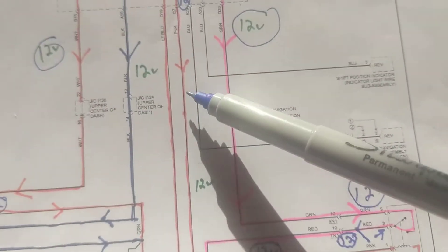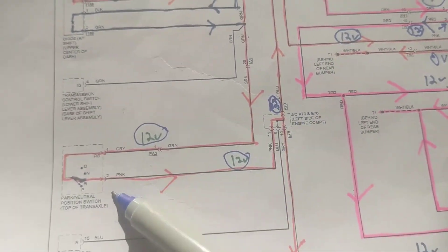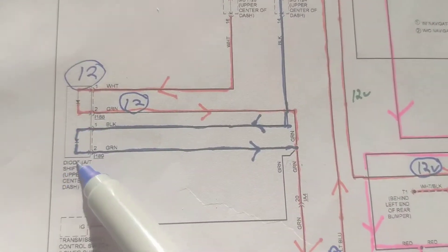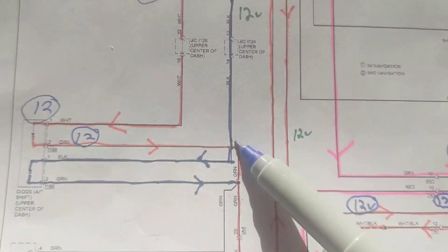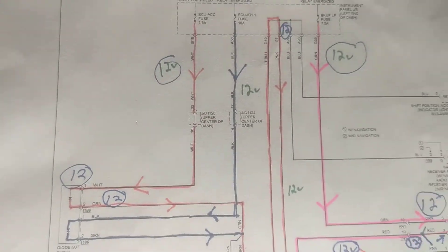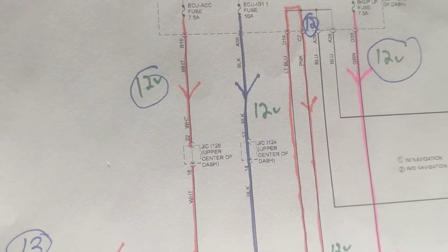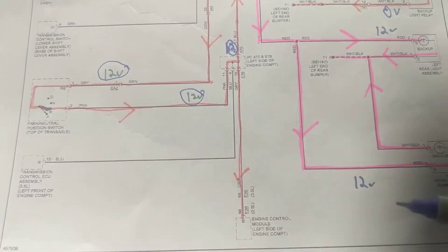This path that goes to the relay actually comes through the switch, through this diode. There are two diodes — current can come from this relay through this diode, or also from the other relay through the other diode, depending which relay is energized. So current can go this way or this way.